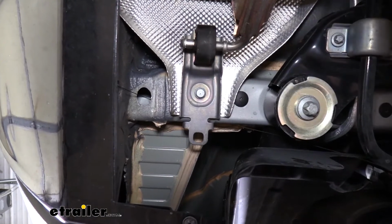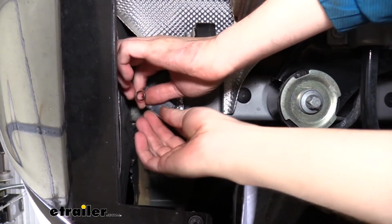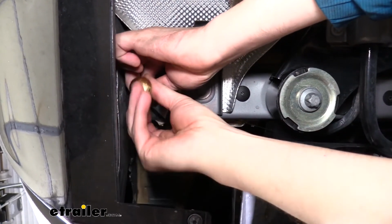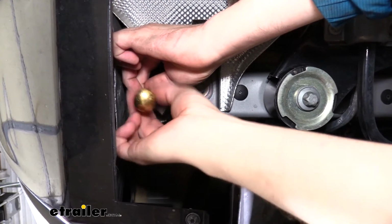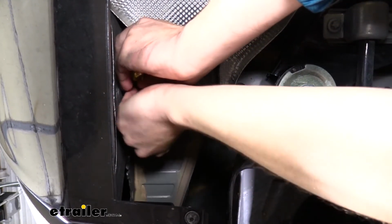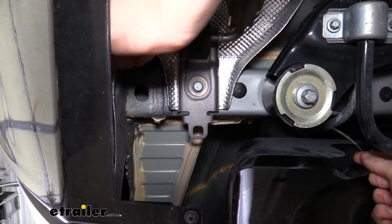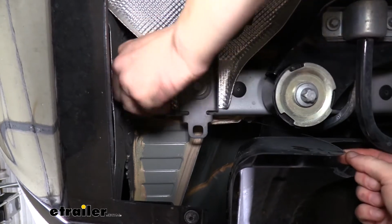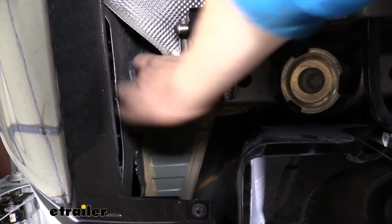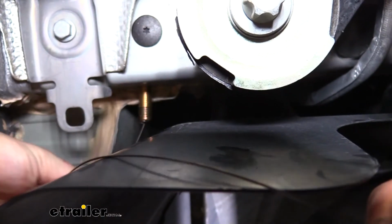Once you've got your coiled end pulled down, we're going to slide a spacer over the coiled end, and then thread on a carriage bolt into the coiled end. We'll feed our spacer up first, and then our bolt, because I found that to keep from having to grind the hole too large, it's easier to feed the head in first, kind of like that, because you can do it at an angle. And then we're just going to pull our fish wire until it comes out the hole.